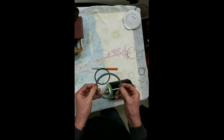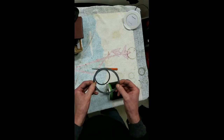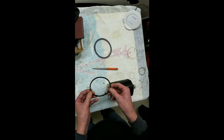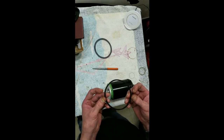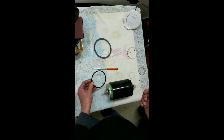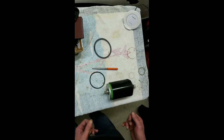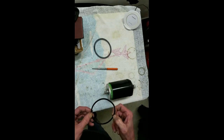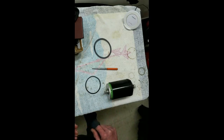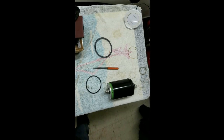On most kits, since this fits the later model cars also, they come with a big old ring — I guess they've got a bigger holder — so you want to take the smaller one. I'm going to put that up into the holder on the car. You want to make sure you get that in straight, and you can over-tighten them — the lip is kind of sharp and it'll cut into these. So don't over-tighten them, but I seem to always get them a little loose and have to snug them up after I start the engine.